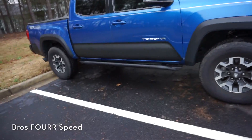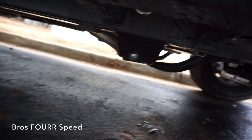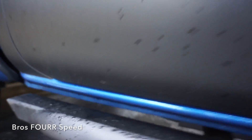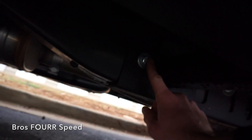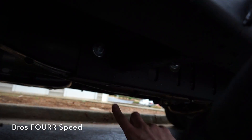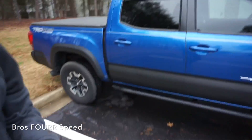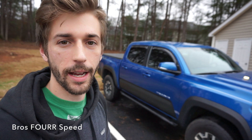There we have it — the installation of my Victory 4x4 rock sliders. Overall it was a pretty easy installation, just very time consuming getting all the bolts and spacers to line up. Every truck is going to be a little different based on the setup. To recap: one bolt on each side in the front, five that run along the outside, and the back is slightly different on each side, plus two optional spots to drill for heavy off-roading. Definitely check out their website down in the description below — if you enjoyed the video give it a thumbs up and smash that subscribe button!